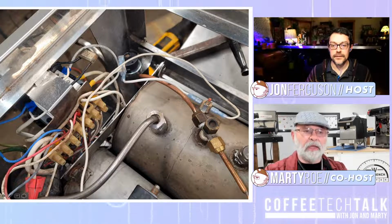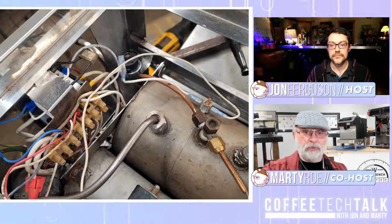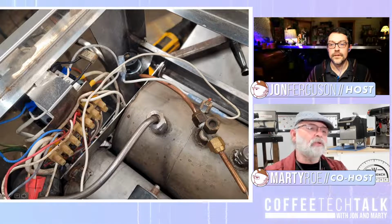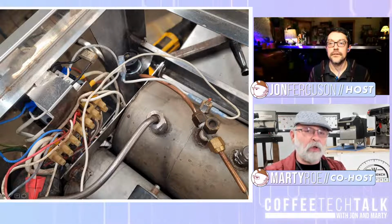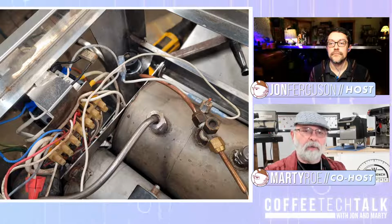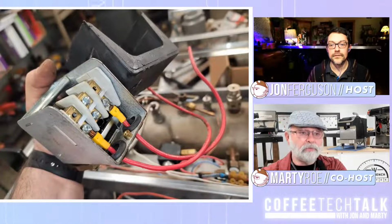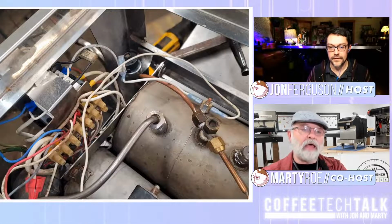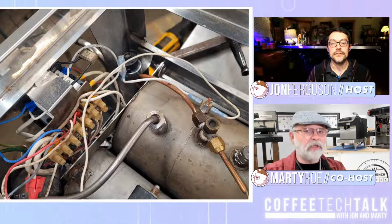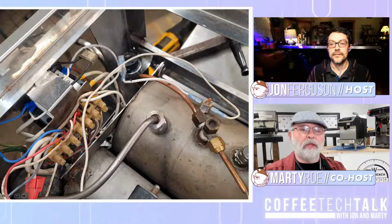What this design does is it pulls in a contactor that's very similar to the pressure switch that you had, that is capable of pulling in contacts that can carry the full load. So the actual load on that micro switch or that small switch is only the electromagnet within that contactor. Your original one was actuated by pressure. The contactor that would replace that, which is off to the left behind all those wires, looks very similar, but instead of a pressure tube going to it, it's got two wires to it, making an electromagnet to pull that in, to send that power in.